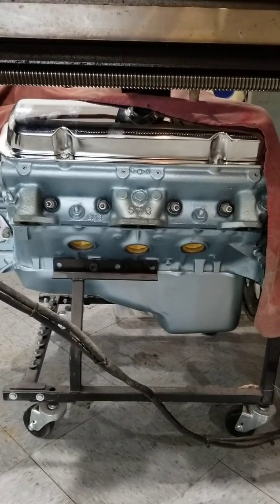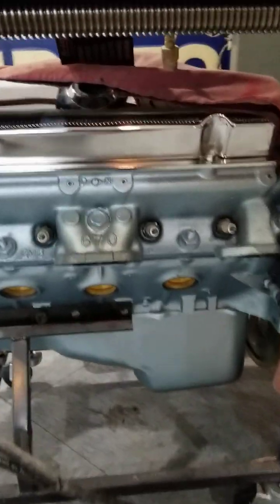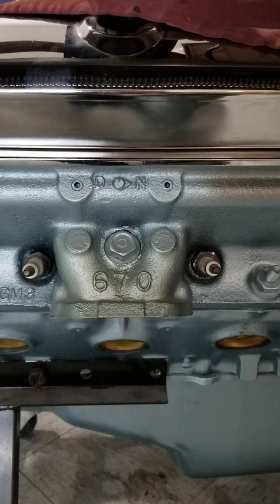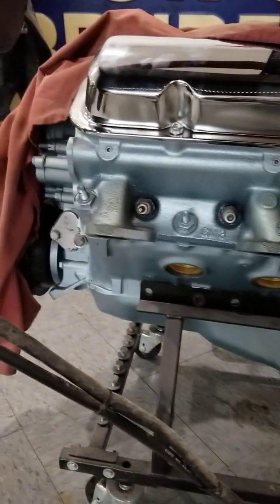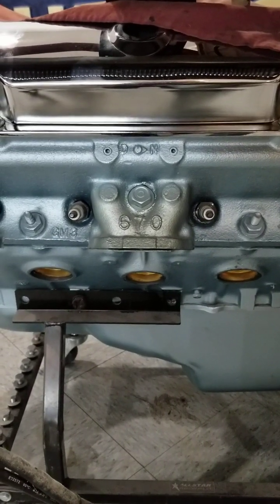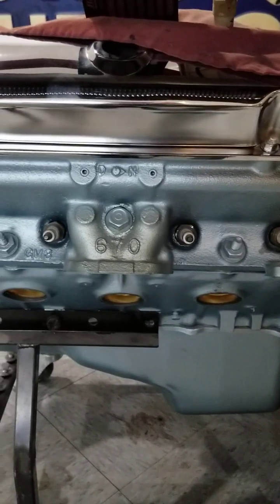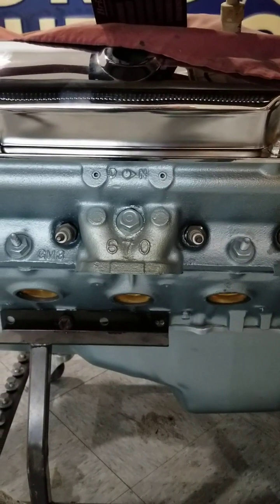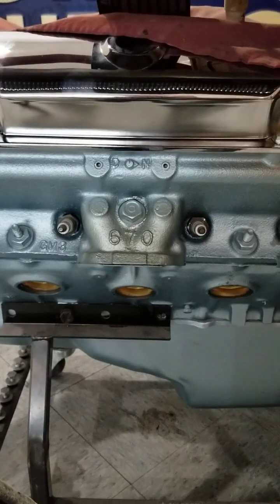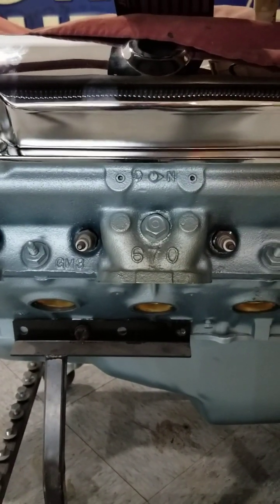They put the casting number of the head on the outside on the exhaust ports. This is a 1967 GTO 400, and it's got a casting number 670 cylinder head. The two center exhaust ports come to like a V shape, and that casting number is cast right on top of those exhaust ports. A lot of guys think it's on the end, and some of the earlier heads it is on the end. Some of the Ram Air 4 heads are on the end too, or the 455 HO head. This particular casting has it on the center, and most Pontiac cylinder heads have it in that location.